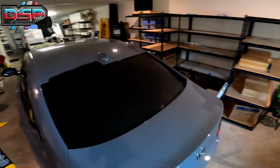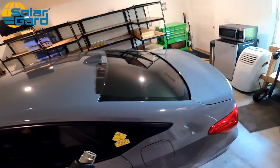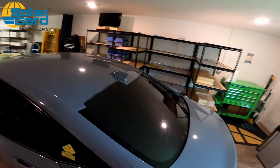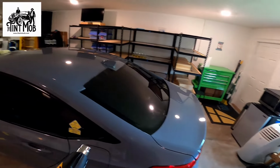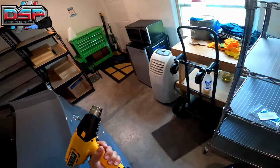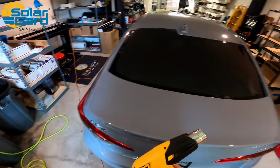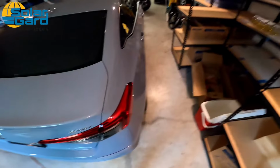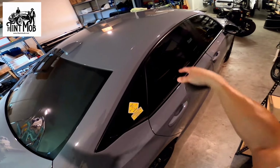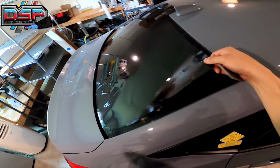The top edge isn't too crazy because you have access to it. And I'll teach you guys how to do that in another video, where you have fingers at the top and you take a heat gun real quickly and then lay it down. But you have to be careful, because you could end up burning the interior. So you have to be very, very careful. Or what people do is they'll shrink the finger and not pay attention and point this gun in a different direction and then burn the inside of something, a seat or something.